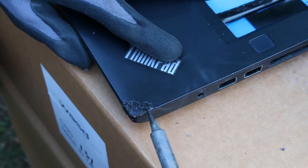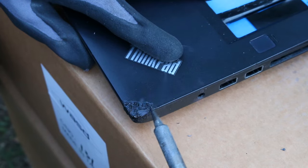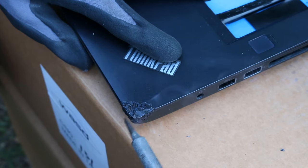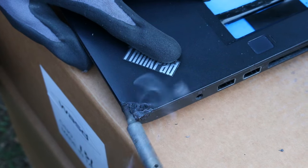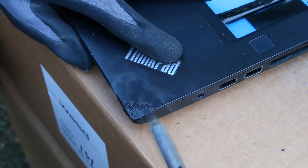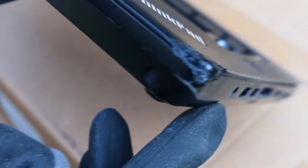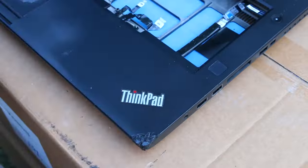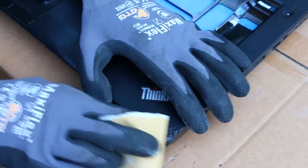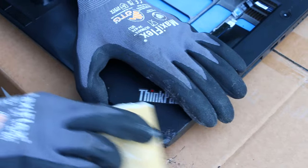You can see I'm using the iron to smooth things out and get the corner roughly in the shape that I want. This is not a perfect pass — we're going to smooth it out and make it look a lot better later. At this step, you just want to get it roughly in the right shape with a little bit more material than needed, because it's easier to sand down, but if you took off too much you can always add more by melting more into the spot.